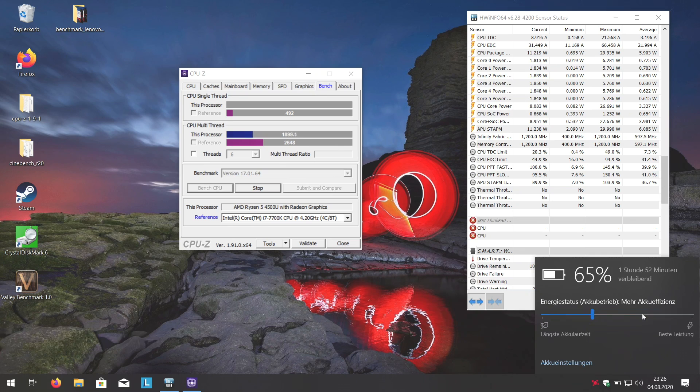Next up are the performance tests. First, one important thing to note: the Windows performance mode has a high impact on system performance, unlike before where it did nearly nothing. This is the first time we saw such behavior in an AMD notebook. You can now adjust the AMD STAPM — the skin temperature aware power management. We noticed four max STAPM modes: battery saving is 10W, the second option sets it to 11.25W, the third to 20W, and high performance sets it to 28W. We tested everything on battery saving and high performance. One small side note: if you want your PC to keep these modes while gaming, you need to disable game mode in Windows 10.